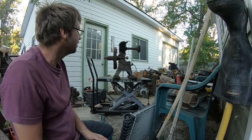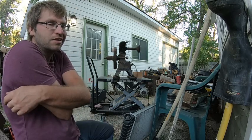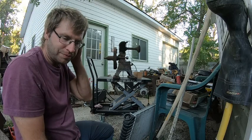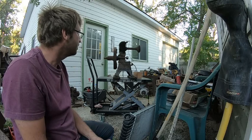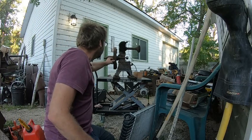Like I said, I squirted some oil down the cylinder before we ran it. And I'm running, it says 16 to 1. I'm running heavier than that just because I would rather it smoke a little bit than get everything worn back in and broken back in. But judging by the amount of compression, it probably never ran very much. I mean, yeah, it's got some play here.